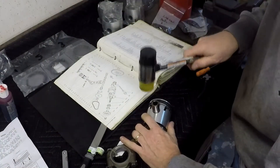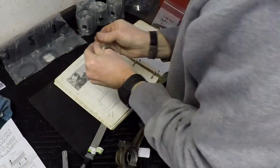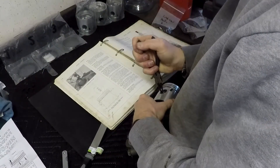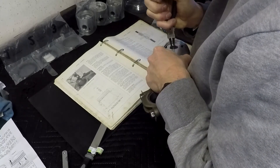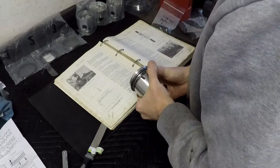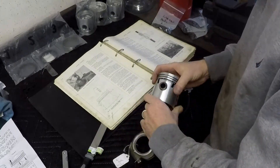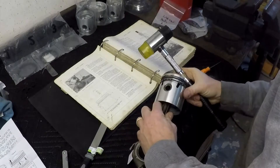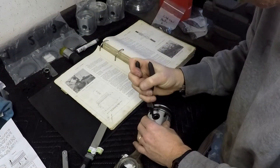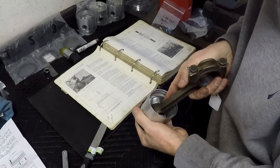Using a soft blow hammer to put the wrist pin in the rest of the way. I got a little nervous towards the end — I didn't want to hammer too hard and crack a ring. The split rings come with the pistons. I put the first one in on the side I was hammering toward to provide a stop so I wouldn't drive the pin all the way through. Then I used a wood clamp to press it most of the way home, followed by a socket and dead blow to drive the wrist pin into the ring pin on the other side, then closed it up with the other split ring.